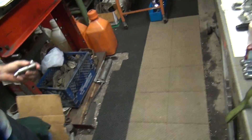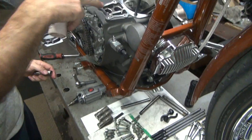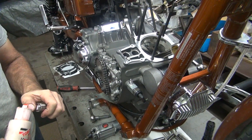You can buy from S&S too. Now we're going to put these back in the motor — you know, this thing over here we're working on, that we got rudely interrupted. Now where did we leave off? Lifter blocks, lifters — we lubed. Lube the bores for the lifters. Now we're going to lube the rollers, because the rollers need to be lubed. Another critical part — it needs lubrication when the motor doesn't have any oil in it.